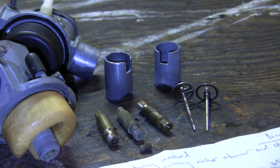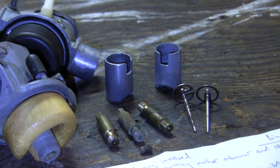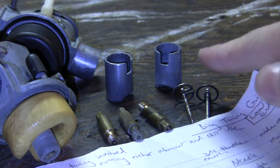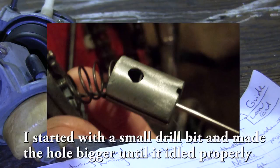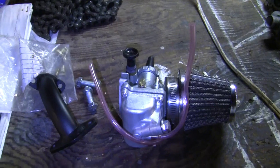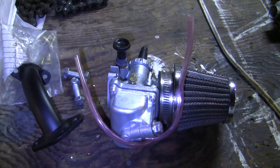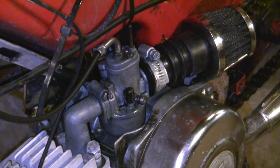If you scan the forums, you can find all sorts of mods people have done to slides. In order to make the slide on the Maxi end work — it was still way too rich to even idle — I had to drill a small hole closer to the top on the 24 slide, since that's already the leaner one. That creates a small air leak, but it's enough where it's able to idle. That multi-circuit carb is starting to look pretty good right now, isn't it? In conclusion, I still really like Bings. I recommend them for stock setups, setups with a pipe and filter, or even a mild kit. You'll have an easier time if your kit has reeds, but I'm making it work for this piston port kit, and you can too.